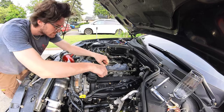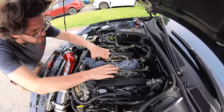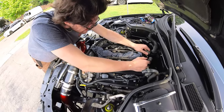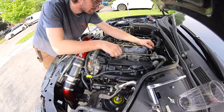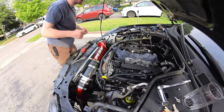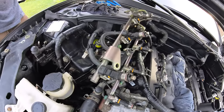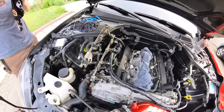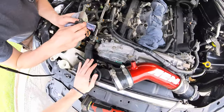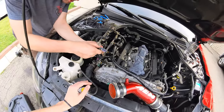See if I'm right, because I believe the injector should be in a closed position right now. So they should hold the pressure that was left. Nothing spurted out yet. Yeah, I'm right. We'll see once you actually take them out, right? I think here they might. Okay, now. Injector ports looking a little cruddy, I'm not going to lie. There's going to be fuel out of this.